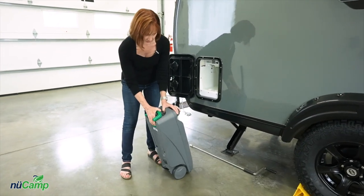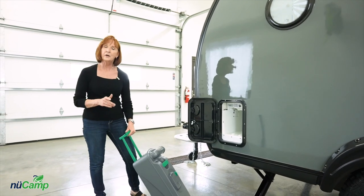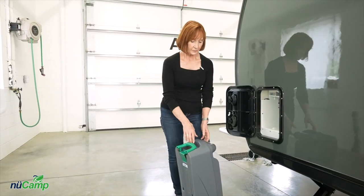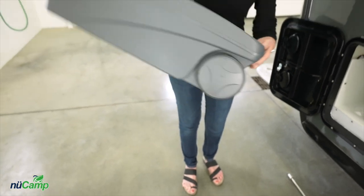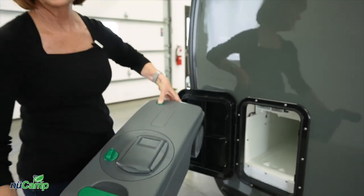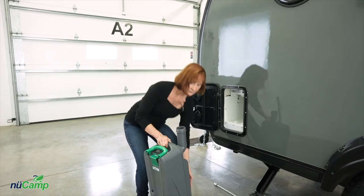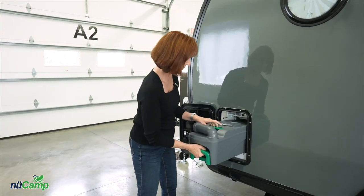Once you set it on the ground, lower this handle down and pull it out to release it — that allows you to take it anywhere you need to go to dump it. It can be dumped at a toilet or at a dump station, whatever's most convenient. To dump the cassette, simply remove the cap at the end of the tube and swivel it out to the side. When you lift it up there is a handle on the back, and push the green button to allow air into the tank so there's no splashing when you dump. Push this down to allow air in, dump the tank, turn it back up, put the cap back on, swivel it back into place, then slide it right back in — it's going to open the flap and lock itself into position. Remember to go inside and put more chemicals inside the toilet to keep that tank nice and clean.